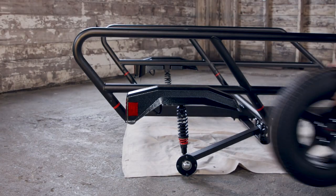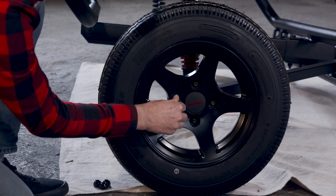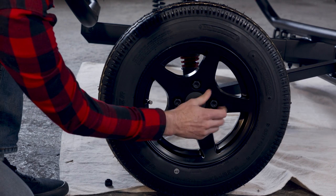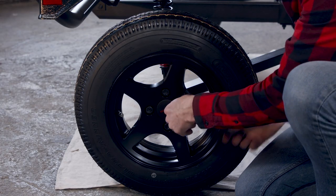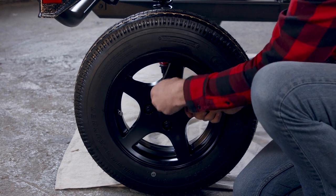Now on each side, mount the wheels onto the lug bolts. Orient your lug bolts — pack two, H16 — like this, tapered end in. Attach them using a deep 21mm socket and fully tighten. Stash this socket somewhere in your vehicle — you'll need it if you ever need to change a flat.